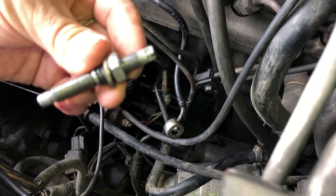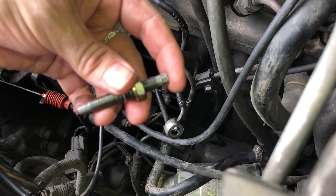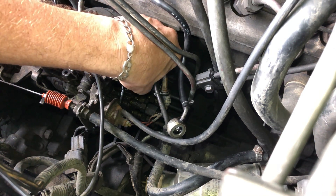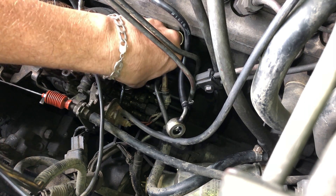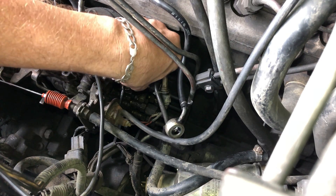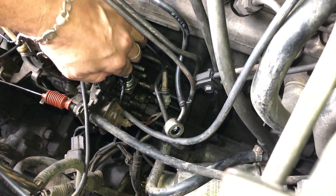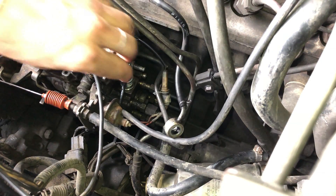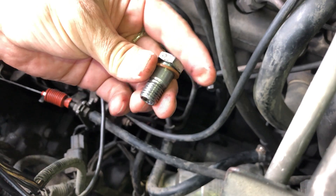This is the maximum fuel load screw — this is the one I adjusted the other day which worked and got me 1.6 bars of boost. I'm gonna put that in now while I've got a little more space. All I know is I've turned it 32 small turns. That's pretty rough but in the ballpark. I'm probably going to wind that back just a hair — it's better to have low RPM and not enough fuel than too much fuel and too much RPMs that you can't control and blow up your engine. So I'll back that off even more; I can always adjust that later.